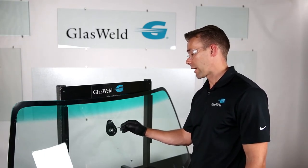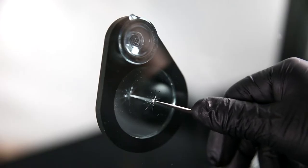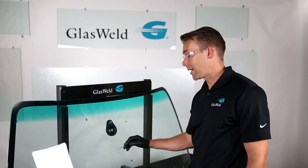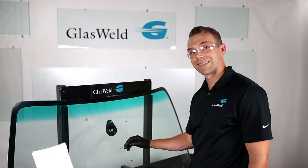For the true star break down here, in all likelihood I would use a gray resin — a thin gray resin as well — in order to help fill all of those legs and hide them as best as possible. So our mirror is on and now we need to prep our break for the repair.